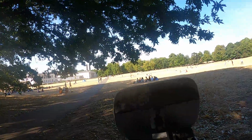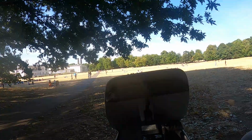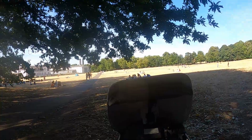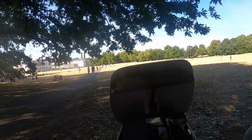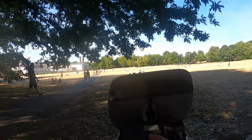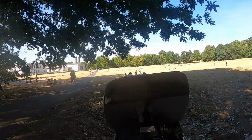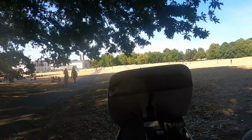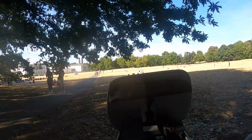I had a quick look at the bolts on the front disc and they still feel good and tight. So I don't know why there's this slight rattling sensation when braking, sustained braking hard at the front. It might be that it needs greater force to induce it, but ultimately they're nice and tight, so nothing's about to fall off. I let a little bit of air out of the front tyre, so hopefully that'll stop some of the bouncing around a bit.